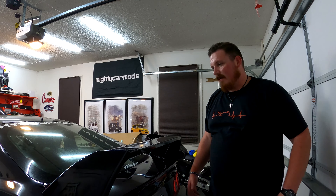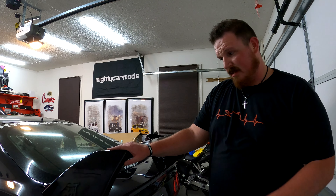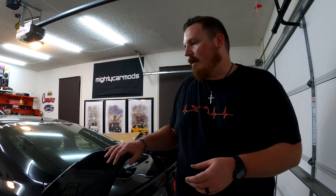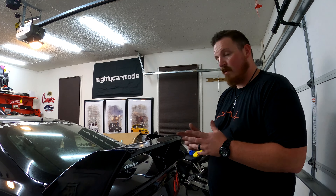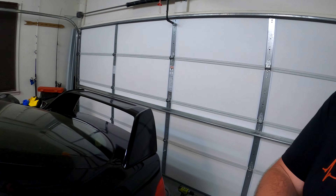Like I said earlier in this video, if you absolutely just wanted to buy this and bolt it on — especially if you don't already have a deck lid spoiler like what comes on my car from the factory — this is one quick, easy way to really spruce up your car. Now, a couple things: this is not a final fitment. What I'm going to do is hit the bare metal with some touch-up paint — obviously a really good idea. Then put a little bit of Honda Bond or some black silicone on the threads just to keep water from getting in. But as far as just throwing the wing on the car to see what it looks like — we've committed, there are now new holes in the car. I drilled new holes in the car — big thing for me, don't like doing that. But it's on.